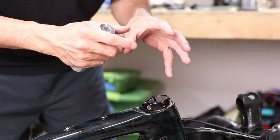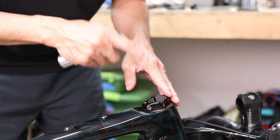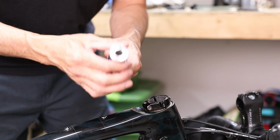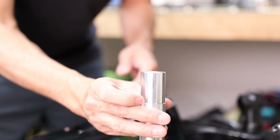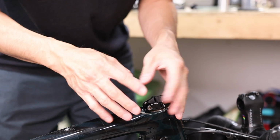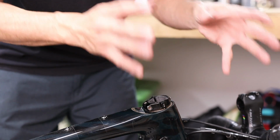Now if your bike came with a specific future stem that was designed to be used with the FutureShock system, you should note that a future stem will not fit on the FSD Slammer Kit, as the Slammer Kit uses a standard 1 1/8 inch diameter steer tube. So in other words, in order to use an FSD Slammer Kit, you need a standard stem.